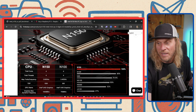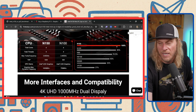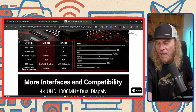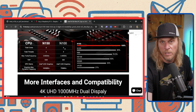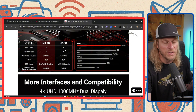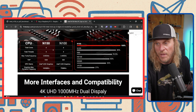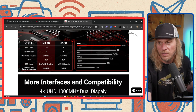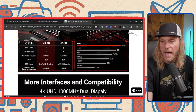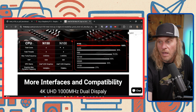It continues with the N150 and lays out the differences versus the N100. They have an overly generalized graph saying the N150 is the best, then 85% for the N100, going down for the N95 and so forth, but they both have four cores. With this, you can do some light virtualization — like having Windows and then running maybe two lightweight Linux virtual machine instances in VirtualBox. You could definitely do that, but putting something like Proxmox on this, I don't think there's really any use to it. It's pretty solid for the home labbing crew, with the exception of gaming.